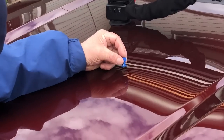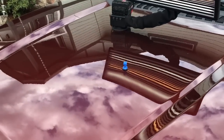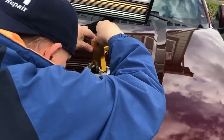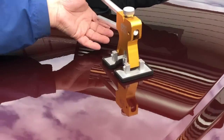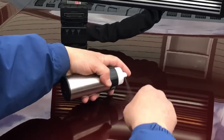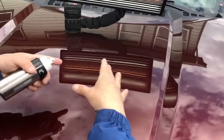I used a big tab and pulled a lot of it out. Going right in the center — dropping it in as it's cooling and grabbing it fairly quickly. I pull it from this angle. Give it a nice little tug in the center — I don't want to snap this one too hard. We're getting some of this dent out. If I need to get behind there with some tools and make tiny pushes, I can. The glue is doing pretty good. I'll make some taps in all directions to make it a little bit larger.